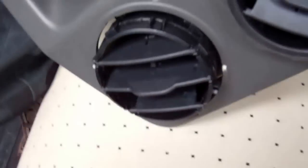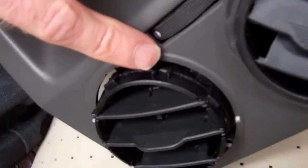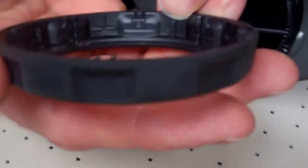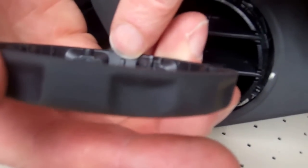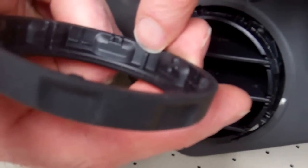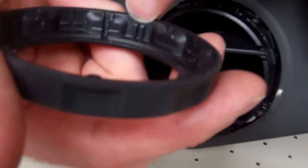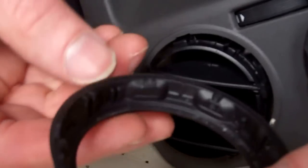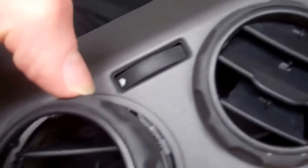To put this back on: you've got this mouth here with two rails either side, but at one position you've got quite a fat one. Then the next three are at 90 degrees and are quite narrow — the rails are closer together. The wide one lines up with the double set of rails, and the single thinner one lines up with one of the thinner rails. So I'm going to line that up and pop that back on.